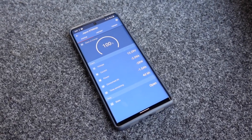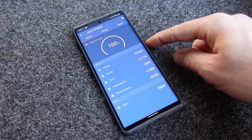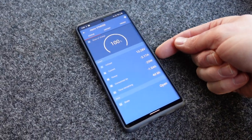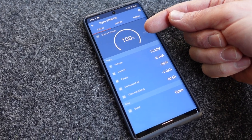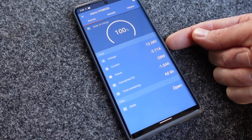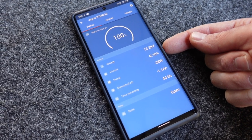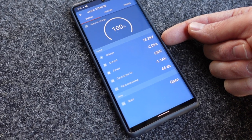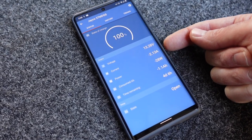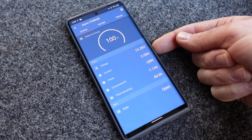Second, for getting an accurate amp draw as the generator is turning over and starting up, we're using this Victron battery monitor installed on the fifth wheel. There's a shunt on the negative terminal going into the battery bank that gives an accurate reading of current going in and out. Right now we're at 100% charge, and the current shows about negative 2 amps — that's the idle draw from the BM Pro system and the inverter on standby. As we start up the generator, we're going to watch this current figure and see what it fluctuates to.